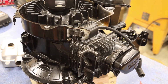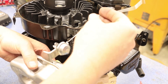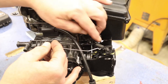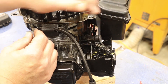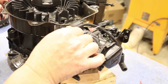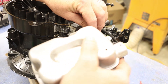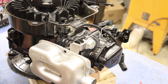Next, let's put on the exhaust/muffler/choke mechanism. Make sure it's oriented the right way — the arm goes in the correct hole on the correct side. Fish the arm connection through, bring it around, make sure everything is clear and working right, then connect the mechanism to the arm, slip it into place, bring it around to the right spot, and go ahead and install the bolts.